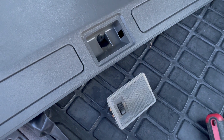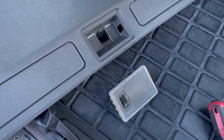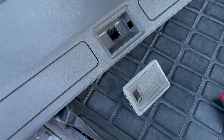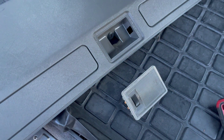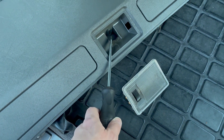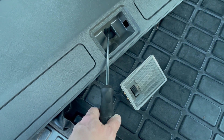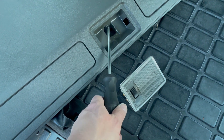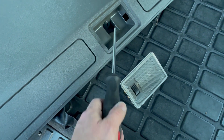When you go to pry the trim panel out from up underneath the headliner, there is a light that you need to pry out — you can just pry it on one side. Looking up at it from inside the vehicle, it's on the left side that pops out. There are three wires to disconnect, and then there is one little clip with a flat head screwdriver head on it. I do that one last, and usually as I'm turning it, it just kind of comes out. Sometimes the clip stays in there, so if you're stymied by this panel, it's probably because of that one clip.